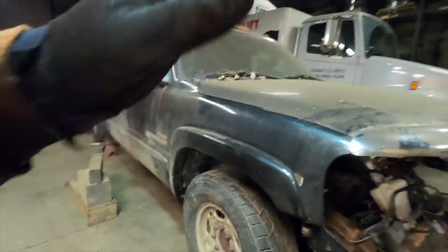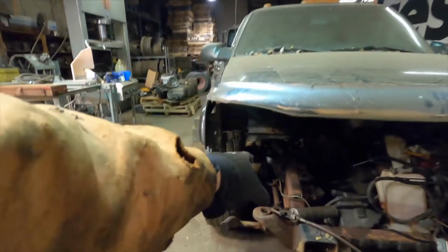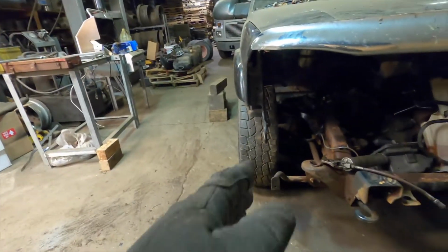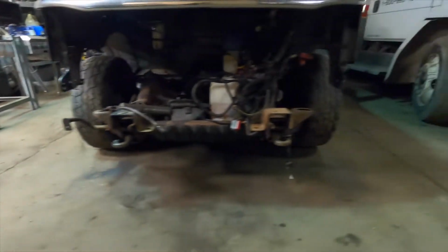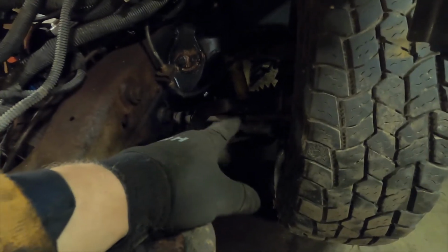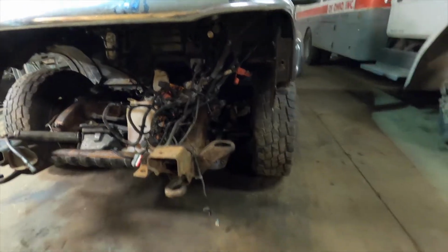All right guys, so a couple of things to leave off on. Everything's on. I only bought the lower A-arms from DJM, and the uppers I was able to bend, and actually they are negative camber, whatever the hell you call it, on both sides. And I went in, and I still need to go in more, but I went in like 1.5 inches on those. It was like 15 turns, maybe like 1.25 inches or something on each side. So that's how much further in the actual hub and everything is in.